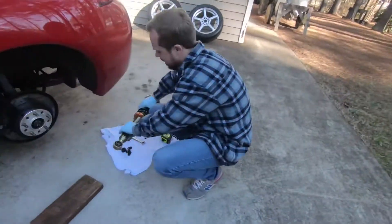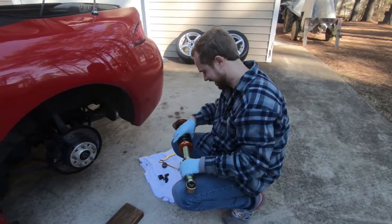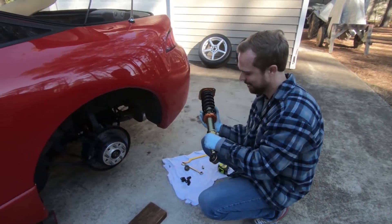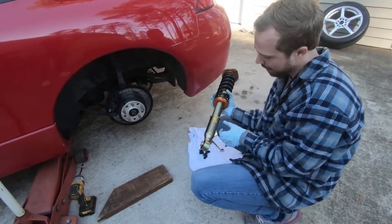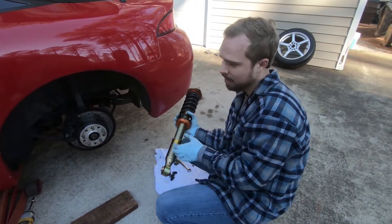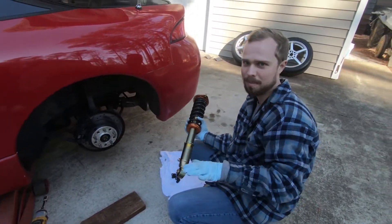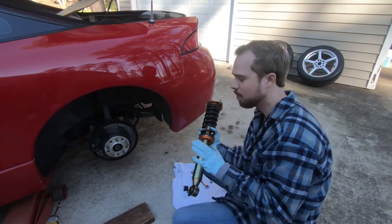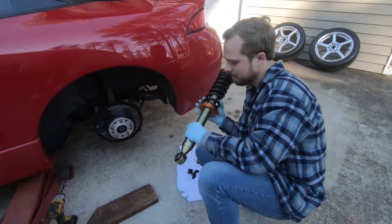Blaine's here to save the day. Austin was in there contemplating life, thinking that his coilovers weren't going to work. So anyway, I unscrewed the body and we've got about an inch and a half of thread in there, which we're going to want to use. I'm hoping we go to the extreme end and then back up. This will probably look really high at first but we'll fix it — if we can even get it in without the suspension being drooped.